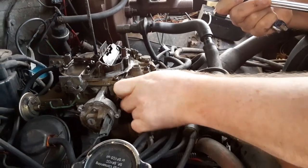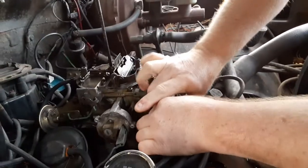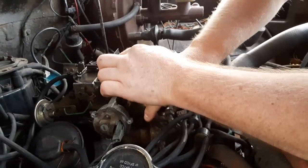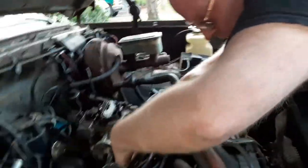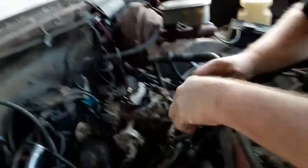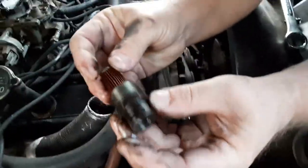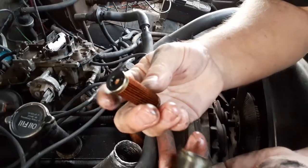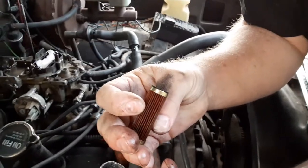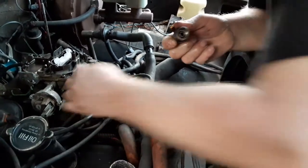I'm curious to see how bad this really is — it may have never been changed. It could be my choke, but it would open up if I really got into it. So there is a spring in there — it didn't fall out. This filter looks pretty bad. It comes apart like this — the rubber goes in there. I did put my fuel filter in backwards once; the spring can stay in there, that's fine, but it goes in like this.